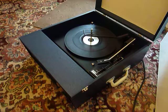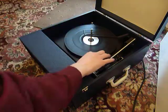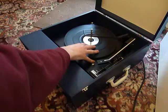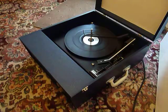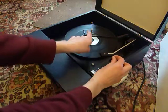The first thing you'll need to do is screw down the two transit screws on the record deck, located here and here, and screw those clockwise all the way down so that the deck floats on its springs. There'll also be a protective cover fitted over the stylus which slides off in that direction.